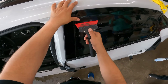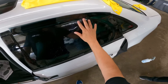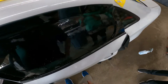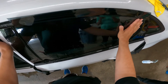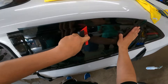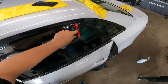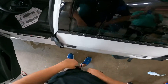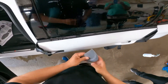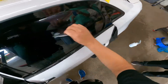I'm going to use the red line extractor squeegee all the way down. There's a gap — there's film right here. You're gonna stretch it with the palm of your hand and rotate. Make sure your hand is dry and you're just going to create fingers, just like that. Squeegee all the way down, across, and then down — remember not to go in and crease it. Then you need to extract all the moisture out with your half moon, create a finger, then heat gun.